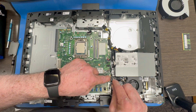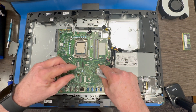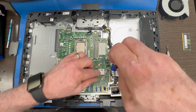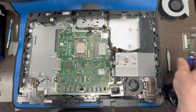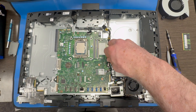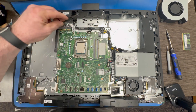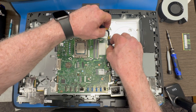You can see here with these kinds of connectors, I like to take that bracket, get it lined up, and then use the bracket with my screwdriver and pull to the left to kind of seat it firmly in place. Get your Wi-Fi card put back in place. If your antennas come disconnected, you are going to want to carefully reconnect those. Sometimes those are difficult to reconnect. I have seen technicians damage those quite a bit and you end up having to get a new Wi-Fi card or antenna cables, and it is just a big hassle.